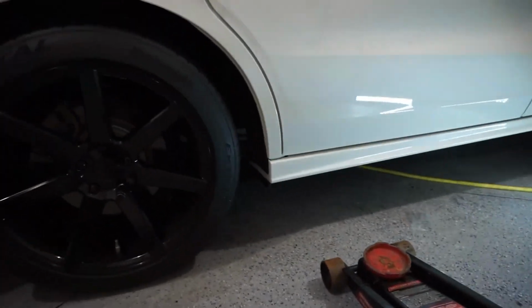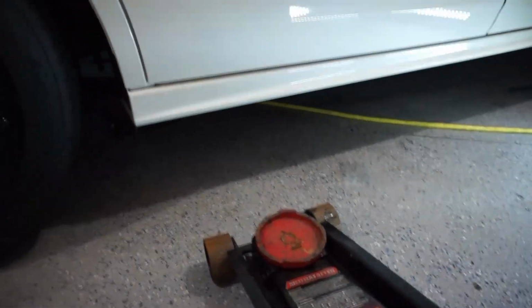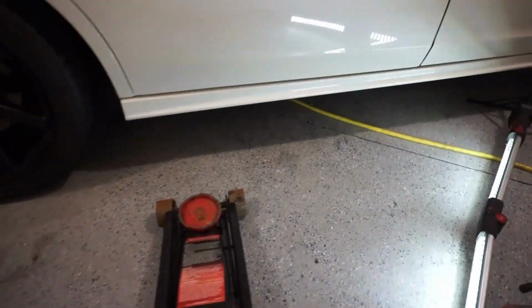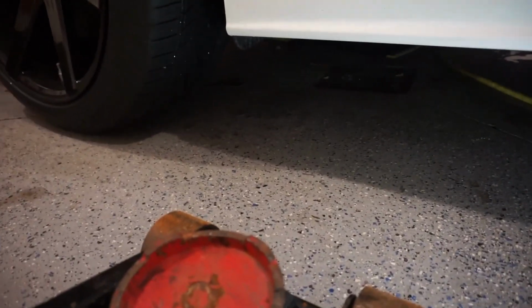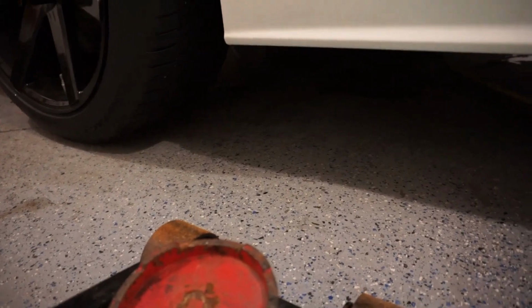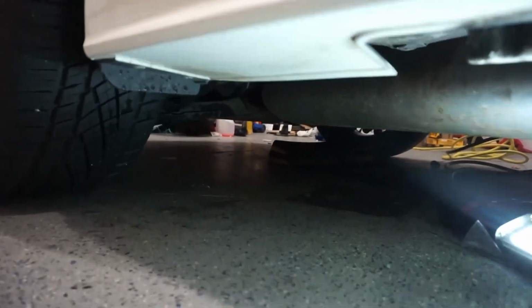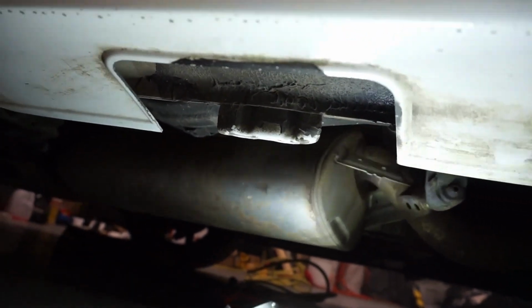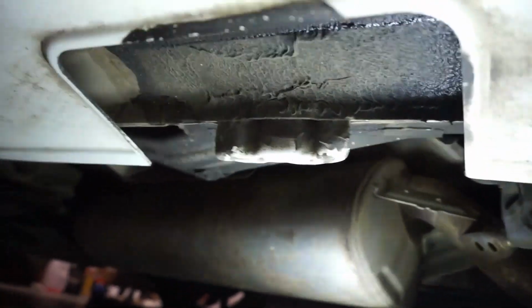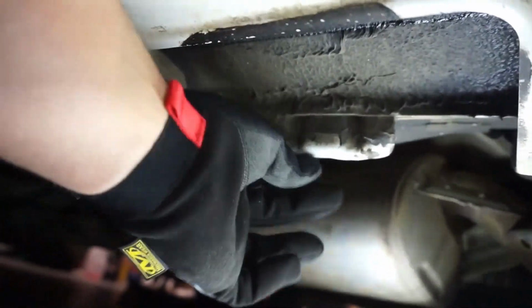Okay, so I'm ready to lift the vehicle. The worrisome part now is, where do I lift? If you don't know, there is always an OEM dedicated lifting point for these vehicles, and it's quite easy to see where. So I'll put my light under there and show you. If I'm looking under the car, you'll see that there's flat plastic everywhere except for right here. And look, there's a nice lip that comes off the car here. That is your jacking point.